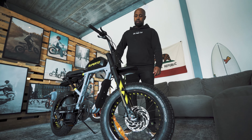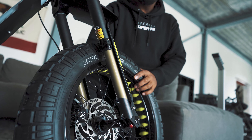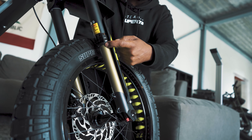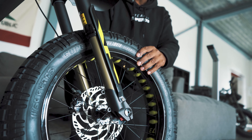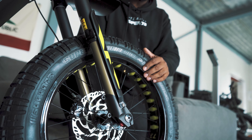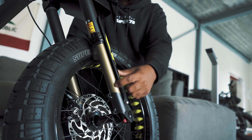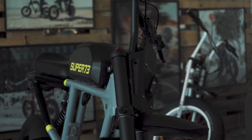The RX is equipped with the upside-down fork, which you can also see on motocross bikes. One of the main benefits of the upside-down fork is that dirt will not stay in the seals, but will flow downwards when the suspension is compressed. Together with the fork protector that protects against upcoming debris, your stanchions will stay clean, which makes you enjoy your ride that much better and for a longer time.